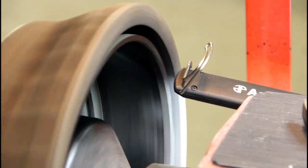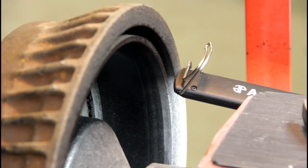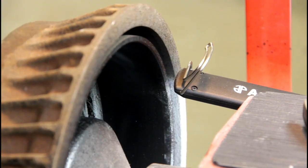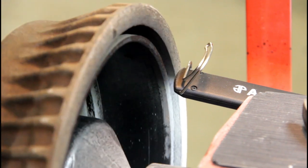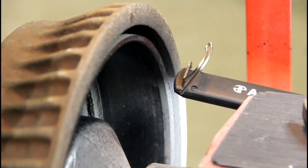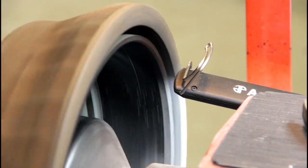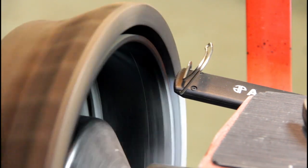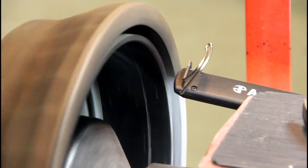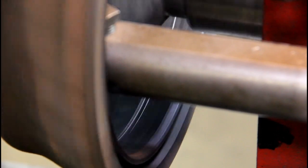You can see the blank from our scratch cut, so we're going to shuffle it off and loosen the drum up a little bit. Bring the cutter head in just a little bit, turn it about 180 degrees, then put the cutter in a slightly different spot and take another scratch cut. Here you can see we're out a little bit, so we'll do that one more time. Now you can see the last two scratch cuts are blending together - took a total of three for this one, but we got it.